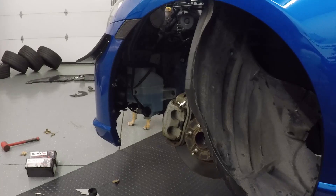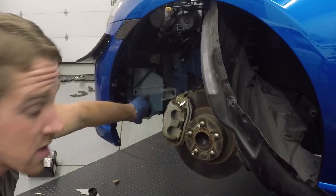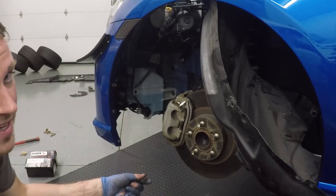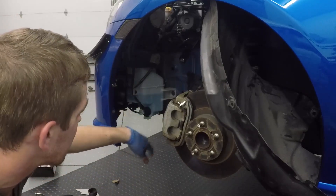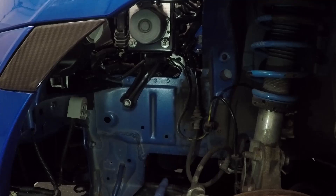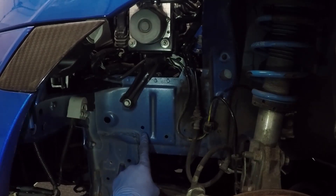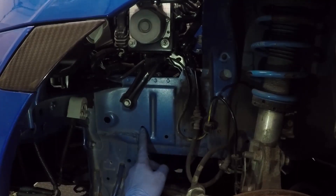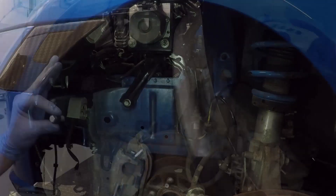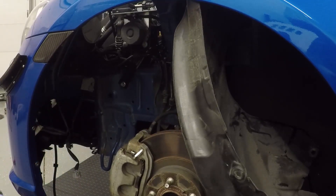On the driver's side we also have to remove the windshield washer tank. There are options on the market for replacement — I believe P-Tuning makes a nice kit — and fluid bags are also popular. To remove it, there's a clip and a couple bolts. Also remove this other fender liner — just a few pop clips. That hole right there is the one we're going to open up with our three-eighths drill bit. Use a shop vac to keep metal filings contained, and touch it up with touch-up paint to prevent rust. Then using your rivet nut install tool, a 9/16 wrench, and a 10mm, install one of the supplied rivet nuts into the hole you just drilled.